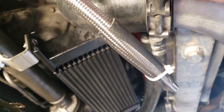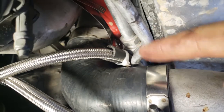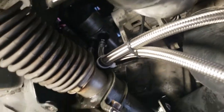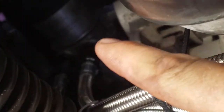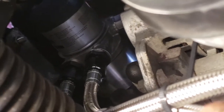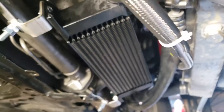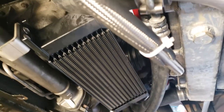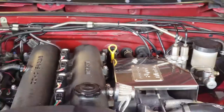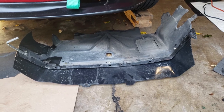I got the cooler mounted and the hoses run. I wrapped a little hose over a zip tie so it won't rub and burn a hole in it — same with the AC lines. The sandwich plate: tighten that nut on the inside, I believe it was an inch and a sixteenth. Then put the oil filter on, rechecked that everything was tight, made sure those fittings were tight, and then started the car. It maintained pressure, no huge leak, nothing blew up — it all seems to be well. All that's left is to check your oil and most likely add some oil.